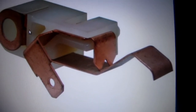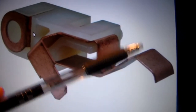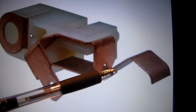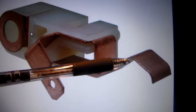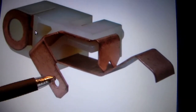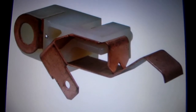The reason the light on my dashboard is staying on is because over time this part of the lever has been pushed down, so it no longer sticks up high enough. When the handle comes down to press it, it's not able to put enough pressure to break the contact. The fix is very simple — I'm going to take this part of the lever and bend it back up so that when the handle comes down it contacts sooner and pushes it down farther to break the connection. I'm also going to use some fine grit sandpaper to clean the contact points, the spade terminal, and the connection, to make sure there's no corrosion.